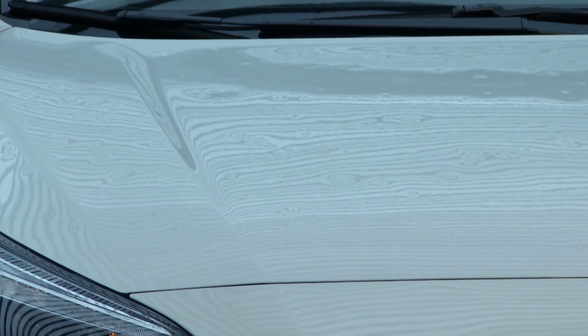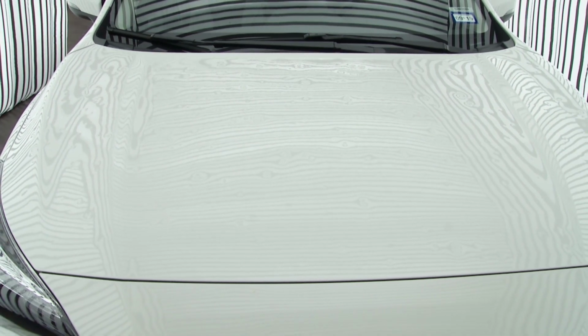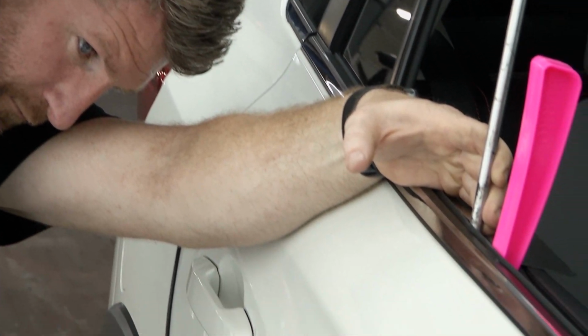So basically what the lines do, again, it's very similar to what a PDR technician's using, is it's not so much that you're putting light on the panel as you're creating distortion and depth perception. That's kind of what the black lines or dead space in between does. So when you're doing a hail estimation, whether you're an insurance company, a PDR company, or whatever, there's a matrix that's used. It's all categorized 1 to 5 dents, 6 to 15, 16 to 30, all the way up, but then also by dime, nickel, quarter, half dollar, and oversize. By creating these lines and that depth perception, you're actually able to see what size the dents are, and the majority of the dents in that panel, because all too often it's just natural for the human eye to just see the bigger dents and miss all the smaller stuff.